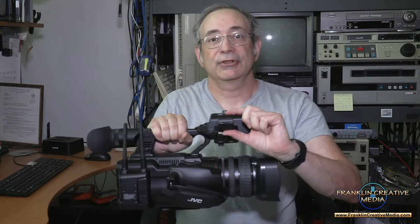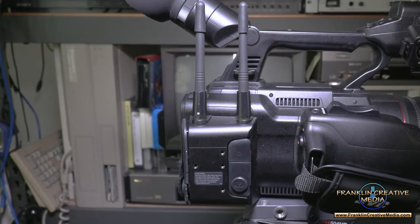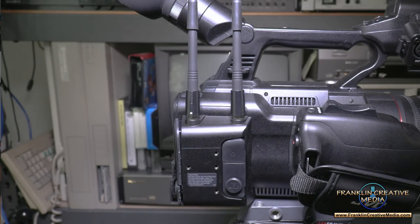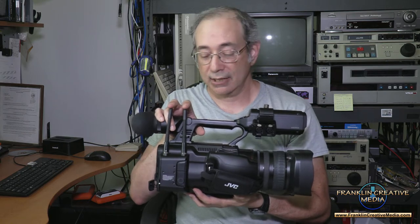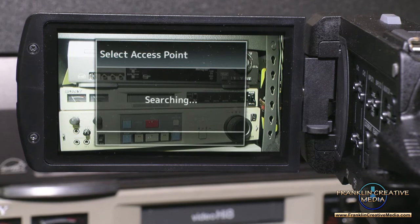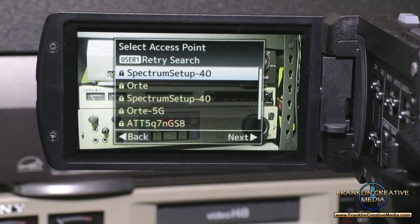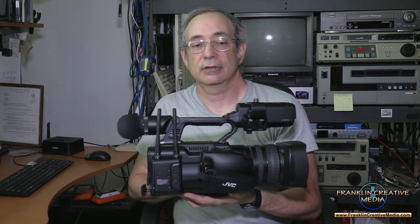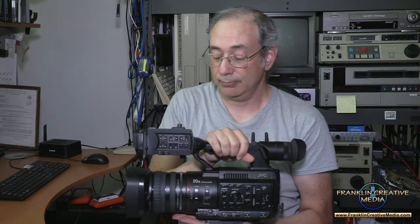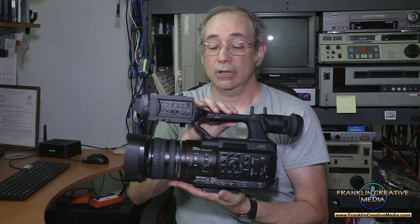It's probably not the microphone mount you're looking at — it's these two antennas. It's not for two channels of wireless microphones. This is your wireless LAN connection. If you want to do a live stream on Facebook, YouTube, and a few other services being added, this camera will connect directly to your network and stream right from the camera. When you go into the menu and tell it to live stream, it generates a QR code on the screen. You use your phone, scan that QR code, and it connects to whatever Facebook or YouTube account you have set up. There is a button for going live, and when you hit that, you go live.